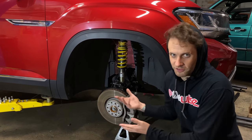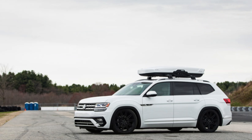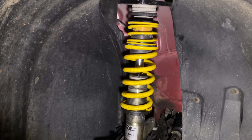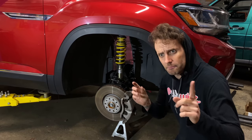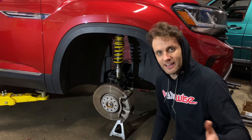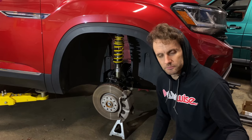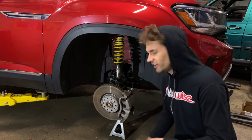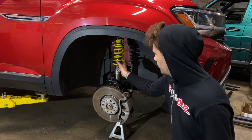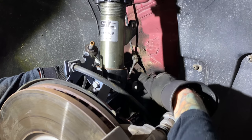First things first — we've got to slam it. This is the same exact suspension we had on the full-size Atlas last time, so I know it's going to bolt up. This is the ST STX with damping-adjustable coilovers, so we can change the damping rate. Last time on the white seven-seater it was all the way up, so we're going to go all the way down on this one. There's a single bolt, then a special spreading tool for the struts — you put it in the back, turn it a little bit, and the strut goes in and out. However, the easiest way is to take off the axle bolt, remove the three nuts for the ball joint, remove the whole thing so it can swing out the way, then put it back in.